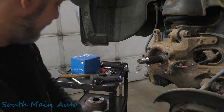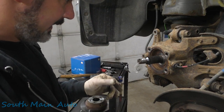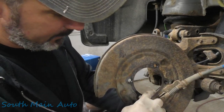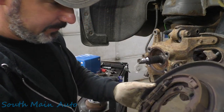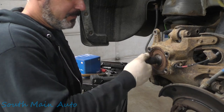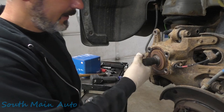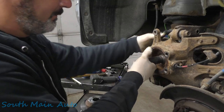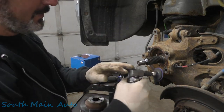It's weird — it doesn't really sound too awful gritty once we have it out, but boy, you spin it with the tire on and all that mass, it's loud. The backing plate here is quite thin and just barely grabs it, so that's fantastic from a seizure standpoint. Same with the speed sensor — it's flush mounted and reads off the tone ring on the axle, so you don't have to worry about the axle coming out and busting off your speed sensor. The whole thing is great. Imagine how great it would be if domestic automakers did stuff like this.